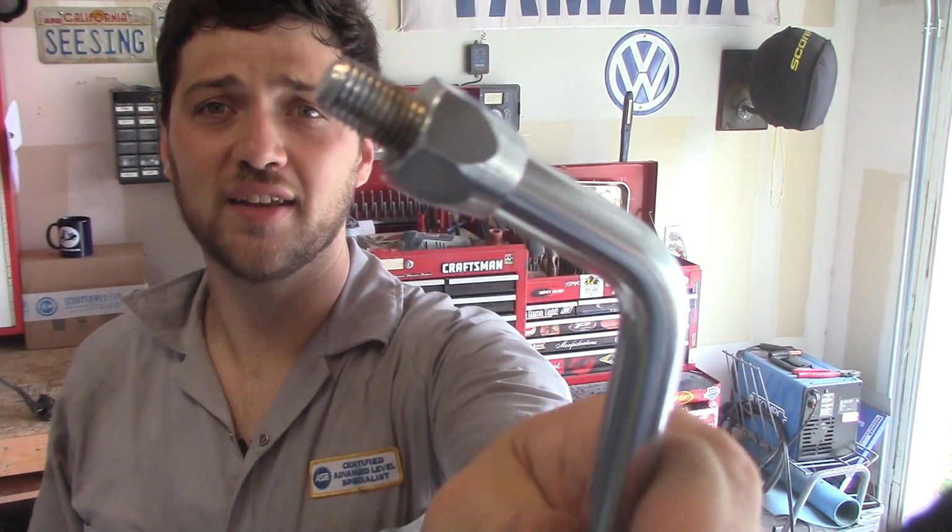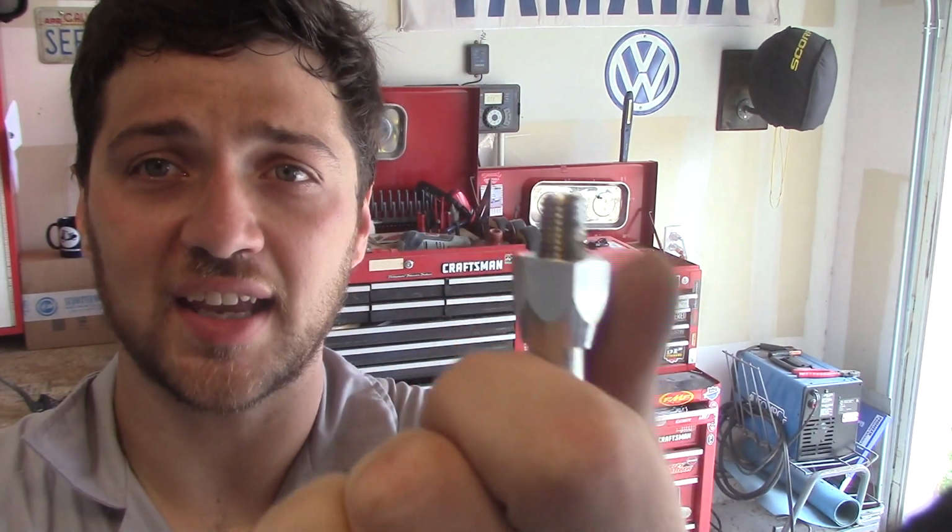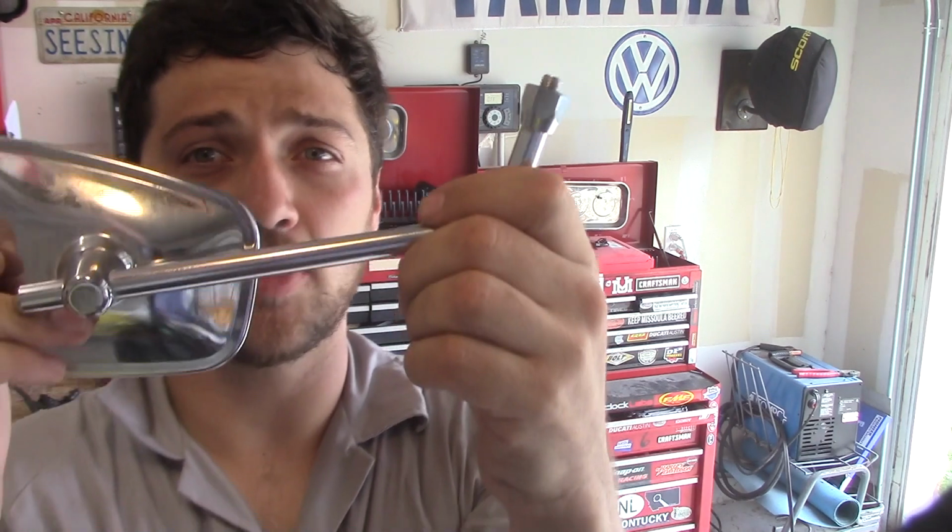As I stated before, almost all mirrors are installed the same way. The threaded end is inserted somewhere in the handlebar by rotating the entire mirror. Then, the jam nut is tightened against the mounting base to secure the mirror in a specific location. Now some mirrors have special left-handed threads on the right grip to ensure that the mirror can be knocked loose in case of an accident.